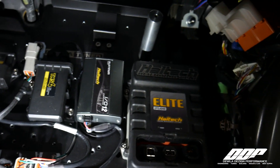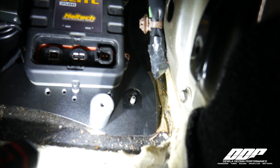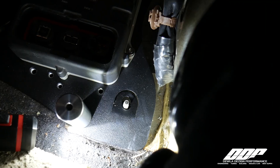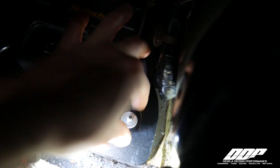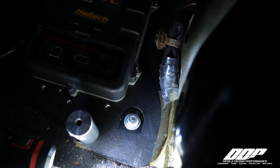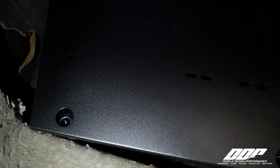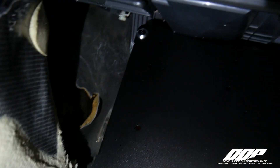Here you can see that we've got the base plate in. We've already started our upper bolts on both sides, left them kind of loose. We're now going to apply our washer and lock nut on the bottom plate. Just take a 10mm socket and go ahead and do that to both sides. The topper is now installed — this will protect your units from your passengers' feet. Four conical washers and bolts are used to install this; you can see the bottom two are recessed and the top two are above the unit. After this, we'll go ahead and put the carpet up.